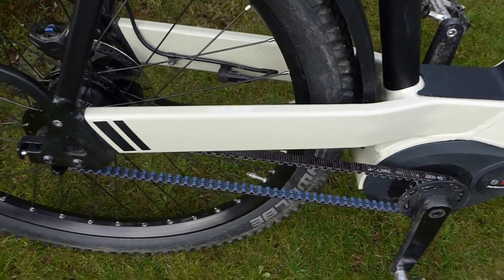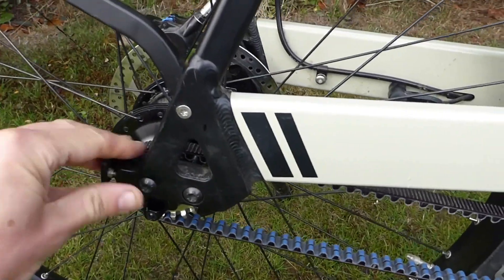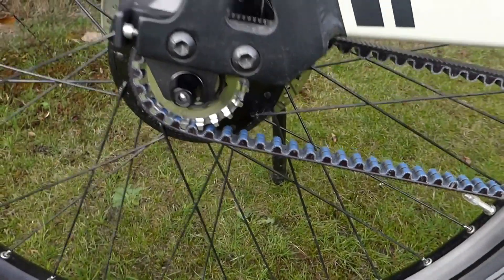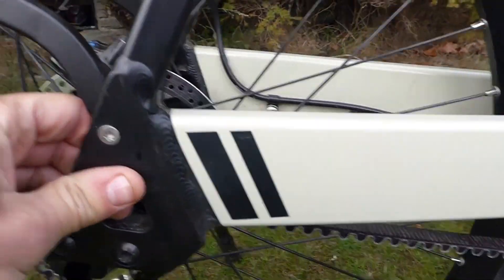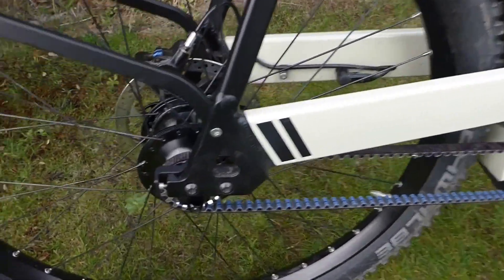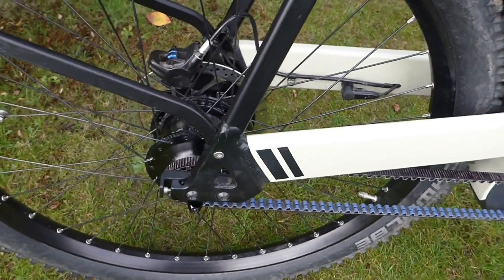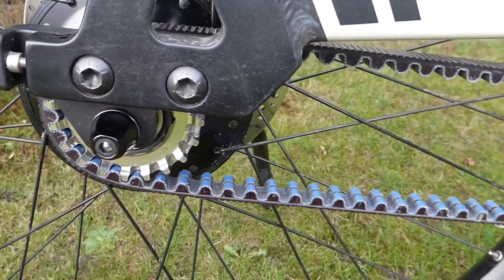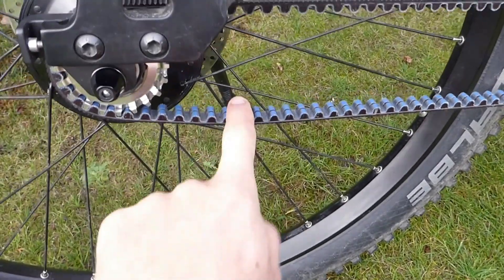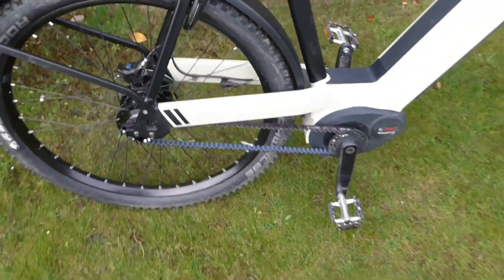At the rear end of the frame, the aluminium alloy members are extremely solid. The belt drive sits below the frame member rather than around it, meaning it's very easy to drop the rear wheel out — just remove the spindle. There's a wide connector at the other side for the electronic shifting; unplug that and the rear wheel drops straight out of the dropouts. Chain tensioning is foolproof because it's a vertical dropout, so the belt is correctly tensioned as soon as you go back in.